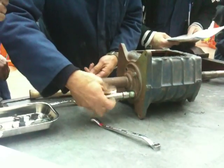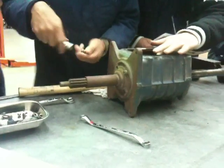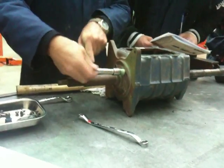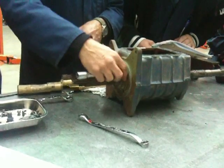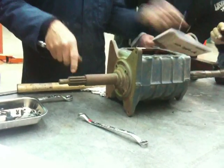This is the input shaft cover, and it's also the front bearing cover. This is first, second, third, and fourth. Basically with fourth gear, because it's what we call a one-to-one ratio, or direct drive, we just simply lock this input shaft to that output shaft.